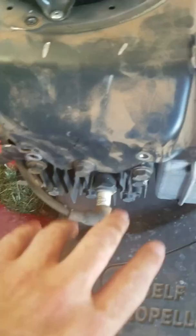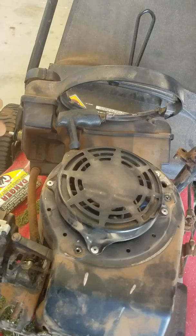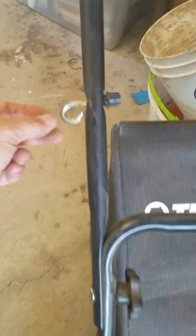I've already taken the screws out. There are two screws here in the front, one screw here and one screw back behind the gas tank. There are three 5/16 screws to undo the gas tank so it can fold back. You'll want to take this loose and it'll allow you to take the pull string out of the way so it'll feed through the hole.